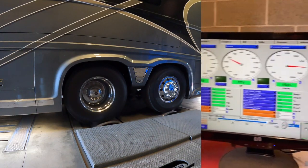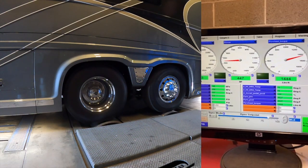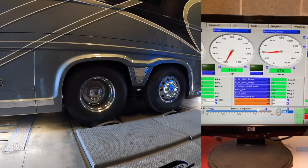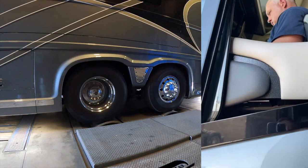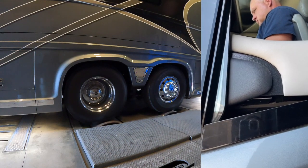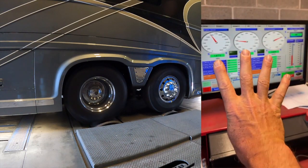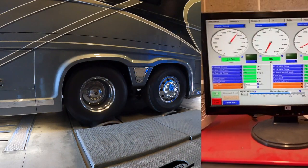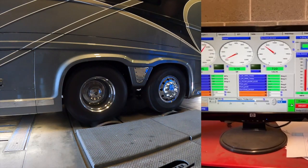If you remember me talking earlier in the week, we were at 1150 peak torque. We were in the wrong gear, but that figure looked substantially better than anything I saw in the first test. Hey, Lou, are you at 4 or 5? 4th? 570. We're in 4th gear. So he's running at 2100 RPM, 67 miles an hour, and he's logging in now.